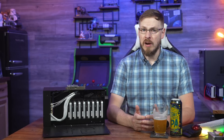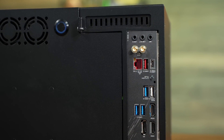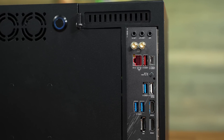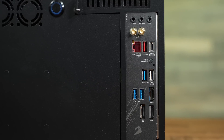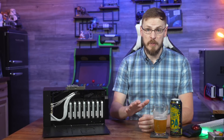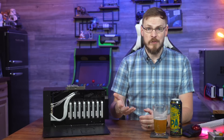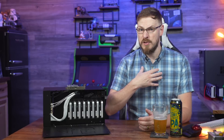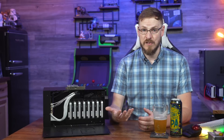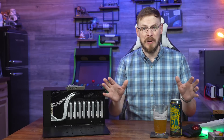The I/O options on this motherboard are pretty solid, with 2.5-gigabit networking, a pair of USB 10-gigabit-per-second ports — one Type-A and one Type-C — and 802.11ax Wi-Fi 6 if you wanted to run this as a purely wireless server, which is a nice bonus of running consumer hardware. Now, one of the things I've always loved about 45 Drives is their approach to software. Not only are they huge supporters of open source, they truly believe there is no such thing as a one-size-fits-all solution. While 45 Drives ships Rocky Linux with Houston UI and usually relies on Ceph for a lot of their server products, my personal preference is Proxmox for virtualization and TrueNAS for storage — and it's great because we can still use what we want.